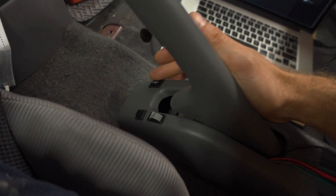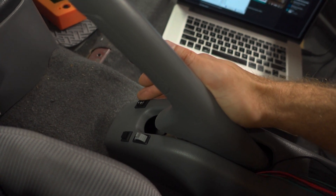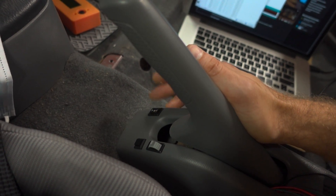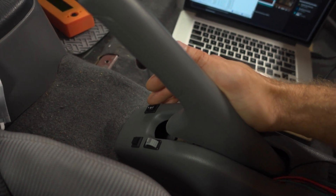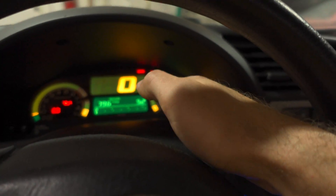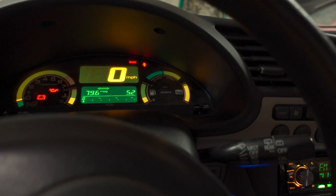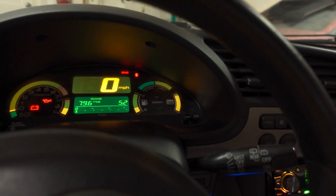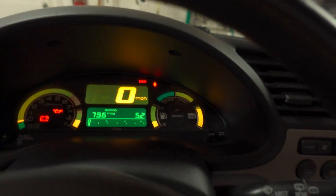The disabled region works well. But I did notice actually when you bring the pack all the way down to empty — with LIBCM down to like 15% or 10% — even though I know I am not sending the regen signals through, the MCM is still regenning. So I think it's not the ECM that's actually forcing the regen. Now I think the ECM has a part in it because it's showing this charge here. When you get up to higher SOC, like 20–25%, and it's still trying to background regen but isn't force regenning — in that case, putting this in mode 2 does actually work and there is no background regen.